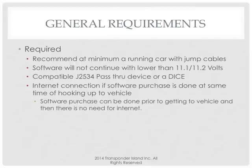For Fords with the newer systems — if a car sat for 31 days without a key put in, the ECU actually goes to sleep. It's a Ford system: after so many days with power but no use, the ECU sleeps. To fix it, disconnect the battery for five seconds — you're rebooting it. Cars anymore are computers. If you're not up with technology, you're going to slowly fall behind in this industry.